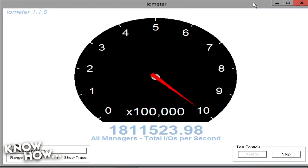So this drive is actually capable of delivering 7,000 megabytes a second of throughput. To get this kind of performance with a SATA-based solution, we would need 24 drives behind three different RAID controllers. Oh my gosh. To be able to produce this type of performance. So basically, we're bringing flash array performance to a single PCI Express socket.